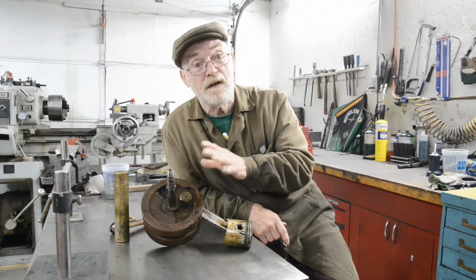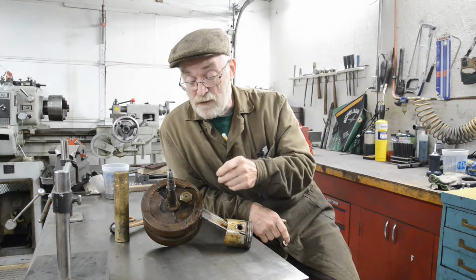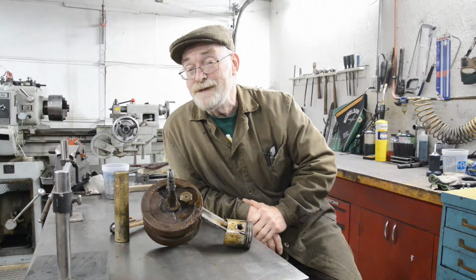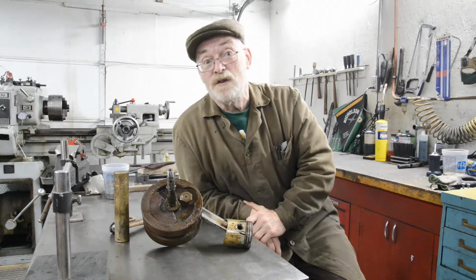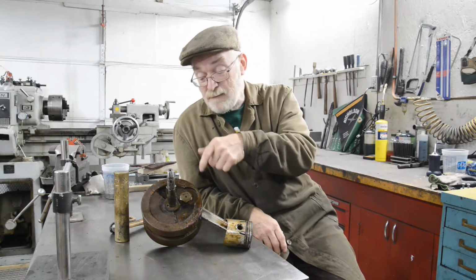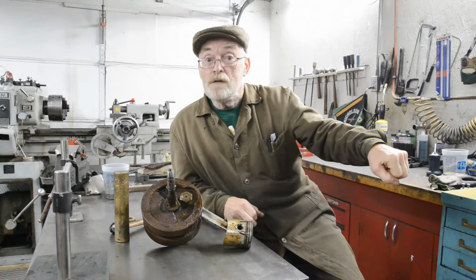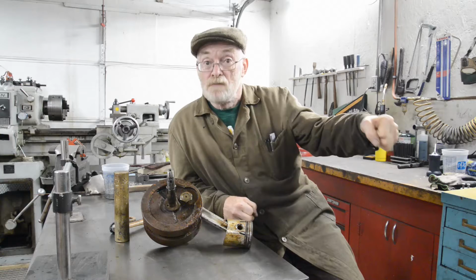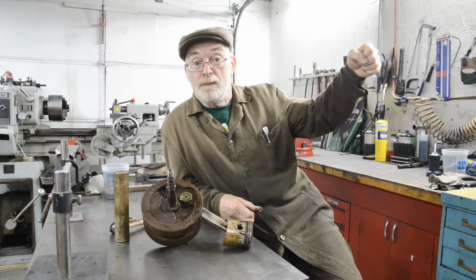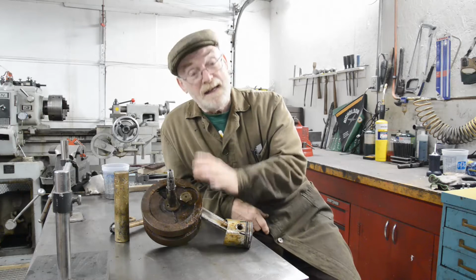The other thing, I don't know what the figure is for this, but I seem to remember that on the Matchless heavyweights, the 350s and 500s, the crank pin nut had a torque figure of something like 250 foot-pounds, because I had to go and find someone with a torque wrench big enough. Even the steam shop didn't have one. In fact, what we ended up doing was we put a socket on it with like a 2-foot bar on, and then on the end of the 2-foot bar we had a spring balance, and we pulled that until it was 125 pounds on the spring balance, and 2 feet long gave us 250 foot-pounds. So anyway, that is really robust.